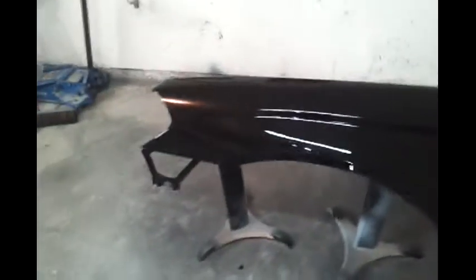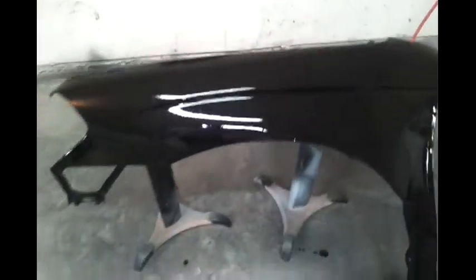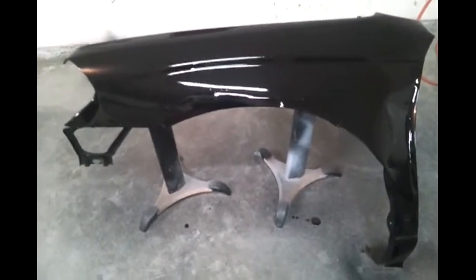And what I'm assuming is that the solvent didn't get enough time to catalyze. So when I started spraying, and I should have known this from the beginning, I first sprayed this, and when I sprayed it, it was like splotches. The pressure was right, I believe. Remember, could be off again because I'm not sure. But that was a problem initially. So then, I should have known from previous times I did, it's not going to get any better. Whether you spray it on a masking paper or you spray it on an actual test panel, it's not going to get no better. And what happened? I started initially spraying it here. When I started spraying it here, that's when I got the splotches.